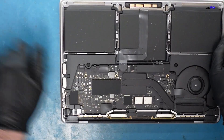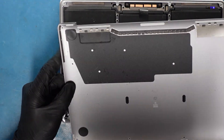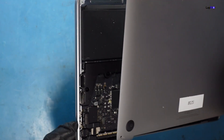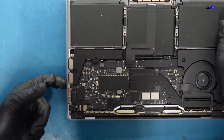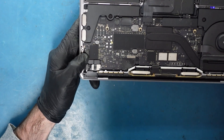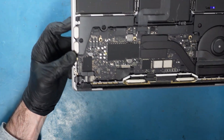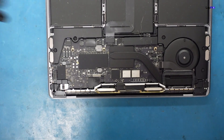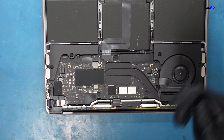Another good way to take a look is over here on the back cover — you can see a little bit of sticky droplets. That's probably in our left area, which is close to where our charging ports are. So most likely there's something there, or maybe a little bit of corrosion on the actual USB-C port itself. If that's the case it's not a big deal — the USB-C ports can be easily replaced with just screws. Let's open the board and take a look.